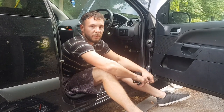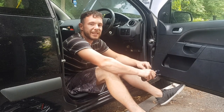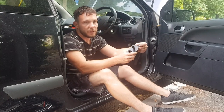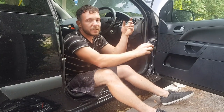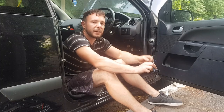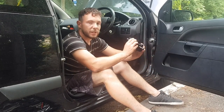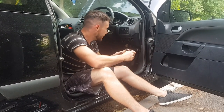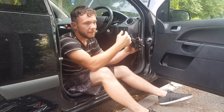As you can see, we've tucked the driver's seat out because you can do it without, but it's really hard to get to. For easy access, it's only four bolts — just whip it out and it's out of your way. The unit itself has got a spring on it — you can see that there. This spring connects to the back of the clutch pedal just to give it a return so it pings back. You can't get to it when it's up there, so I've had to take the clutch pedal off first just to get the spring off. The unit itself is stuck up there with just two bolts.